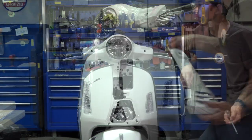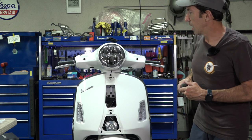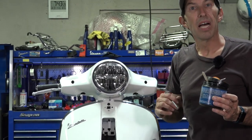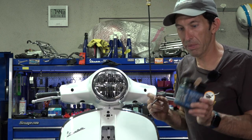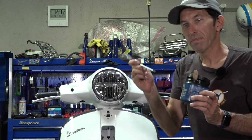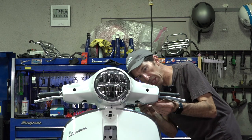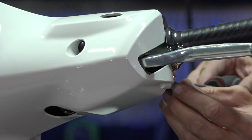Back to the handlebar covers — it's pretty important to get these out of the way, especially if you're going to remove the glove box and the floorboard. It is possible to do it without, but it's pretty difficult. To prevent dropping screws, use something like this really gooey grease — Maxima waterproof grease — and dip the tip of your screwdriver into it so it holds the screw as you pull it out. There's a pair of screws in the chrome covers at the very far ends; there'll be a little washer behind each screw.